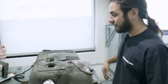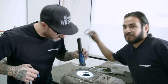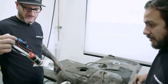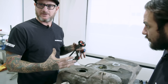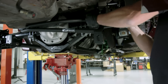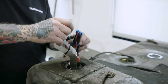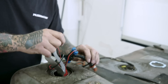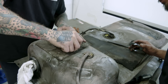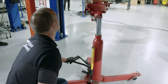Jay's ready to drop in the Aeromotive fuel pump. It's supplied with a new O-ring and the new ring for the top. We're just making sure there's nothing weird in there — it goes in one way only. There's a little area in there that catches the fuel so you don't ever starve. This is the return line — got to be careful, I don't want to break a wire. There we go. One more — there it is.